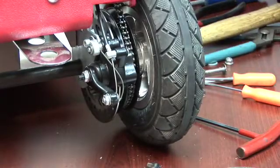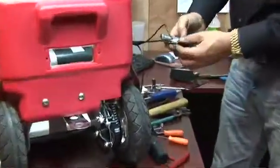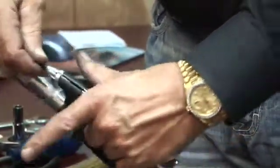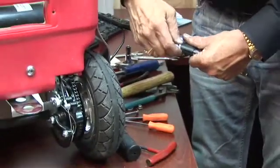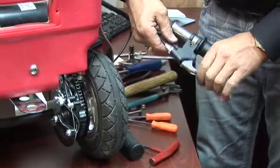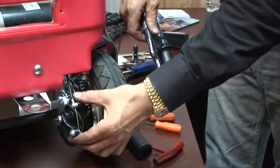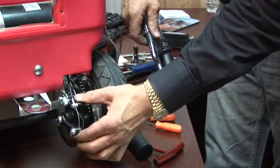If we look at the brake lever, we can see there's an adjustment here — a lock nut and an adjusting screw. If you notice when you pull the brake it starts pulling down there, you can adjust this out and put the lock ring back. This adjusts the brake tension for fine tuning. If you can't get it in range to stop, come back and tighten the cable a little bit more by squeezing it, loosening the nut, and tightening the nut back up.